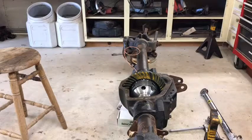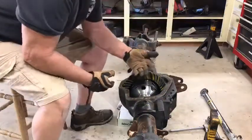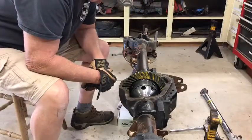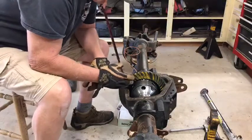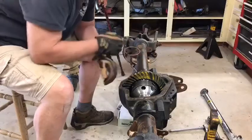So now it's time to summarize. I've got to take it apart again. I need to move the ring and pinion over this way to decrease my backlash — it was a little bit over spec. I think they wanted 6 or 8 thousandths; it was closer to 12. So I have to move this over and put a small shim on this side.